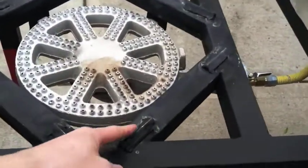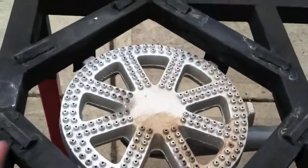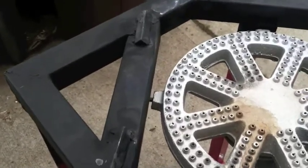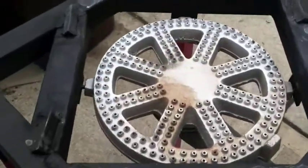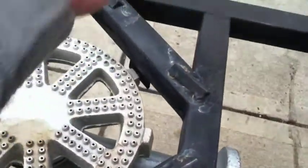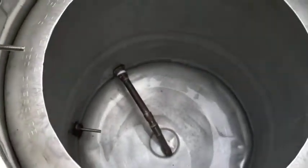I'll show you what it looks like on one of the burners. Under the kegs it's a little dirty and a little rusty because I didn't paint the bottom of these standoffs, but I'll buff them out and clean them off somehow — same with the burner, a little dirty. This is one and a half inch square tubing, 16 gauge. I welded those to fit so the burner would fit. Quality control on these burners is terrible — none of the holes line up. The kegs sit on this, which allows the gas to escape; it's about as high as I'd want them.